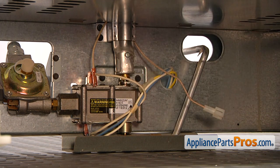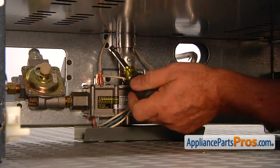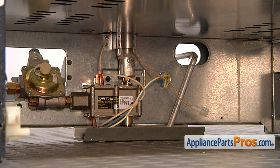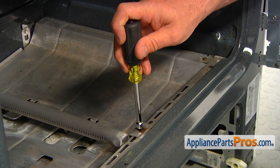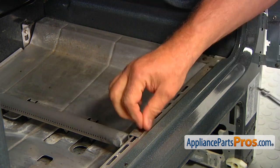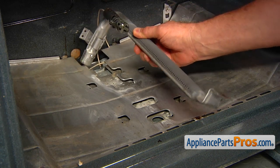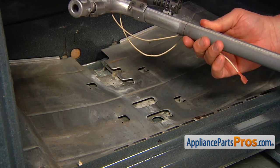We're going to use the quarter-inch nut driver to remove the steel screws — the screws are holding the burner. Now we're going to go to the oven cavity and take out the quarter-inch screw from the top of the burner. That's the last screw that holds the burner, so now we're going to remove the burner by pulling it straight up. Take it to a workable surface and we're going to replace the igniter.